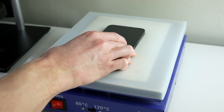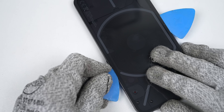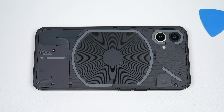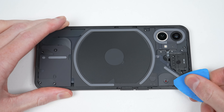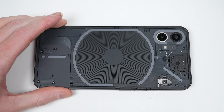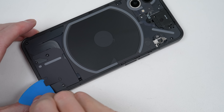Getting a look at the rear panel, you can see it has been slightly tinted. Before proceeding any further, I'm going to get the back off my other Nothing phone. From a glance, the internals of this phone look unlike any other. There are a number of aesthetic details that serve no purpose other than to cover up aspects of the phone. We'll need to remove those first so we can access the screws beneath. At the base of the phone, the lower LED array can be unadhered. I'll need to pry carefully as there's a cable attaching it to the charging port beneath.